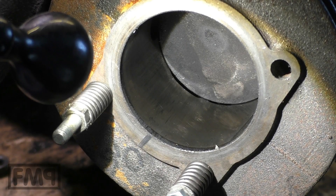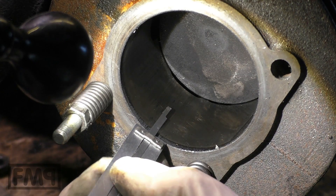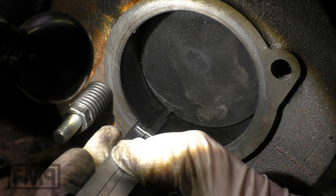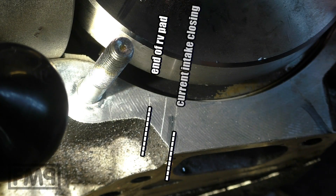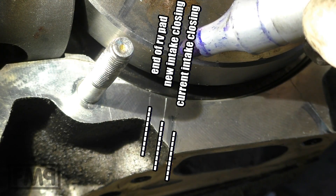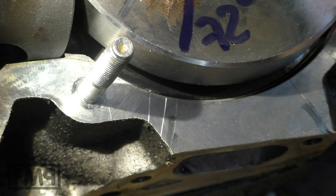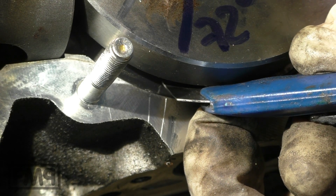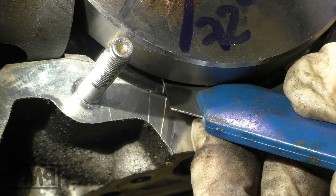For 72 degrees we have 23.85 millimeters, and we have the measurement here. Now you turn the piston until it reaches this value — here, this means 72 degrees. I have a trick to mark the cheek down there — and now I scratch it. That's enough.